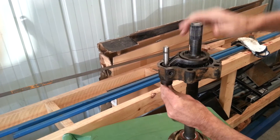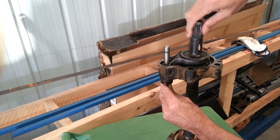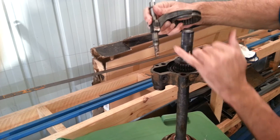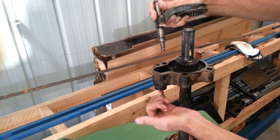I notice that on some of the Gen 3s, they get a grinding sort of sound as they're trying to engage at times. I find that most of it seems to be coming from the wear marks on this shaft binding in the sleeve here.